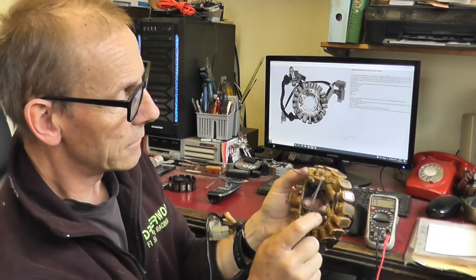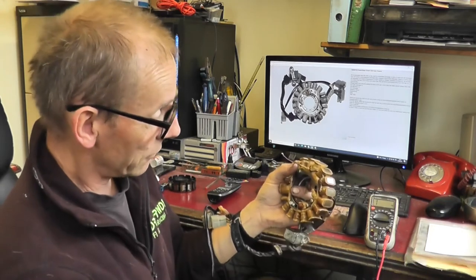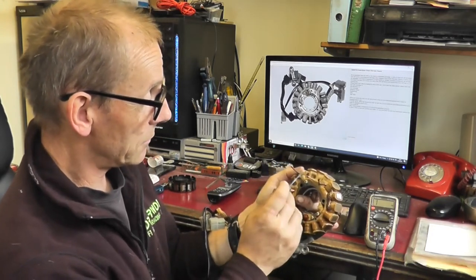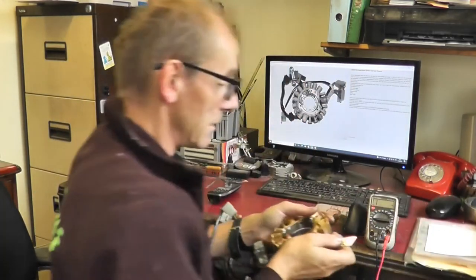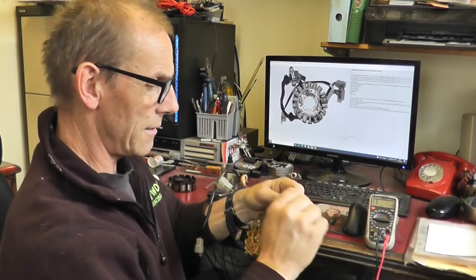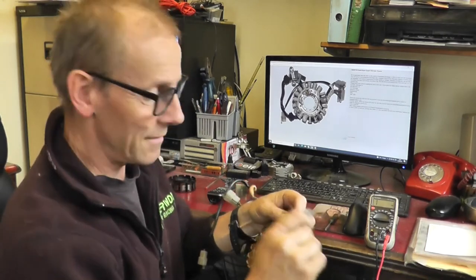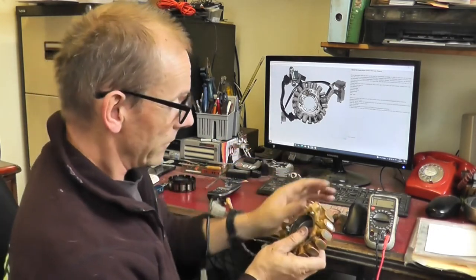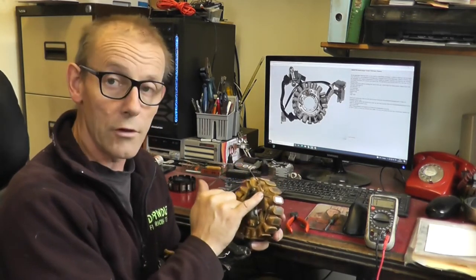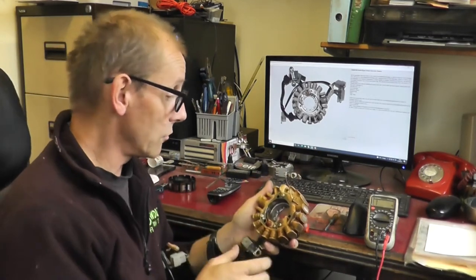High speed source coil — there's a junction: three wires. One wire goes into the coil, the other wire comes up to the white wire, and this is the wire that came up to these two coils. So let's just get a Stanley blade and see if we can cut them back and get a bit of exposed copper. Right — there should be no continuity to ground on that, none at all. I'm suspecting there is, because we were getting a low ohms reading on these two source coils.